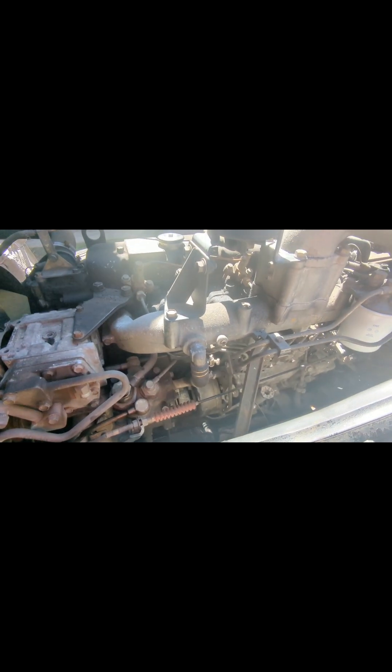I imagine these old mechanical injectors are probably not sealing correctly, but I'm starting here. This is kind of a cheat — if you're low on compression or your cylinders are worn out, according to what I've read, you can advance timing a little bit and it helps. It's like a quick fix to get you down the road. It's not the right way to address compression problems, but it might get you a few more years out of your tired old truck.